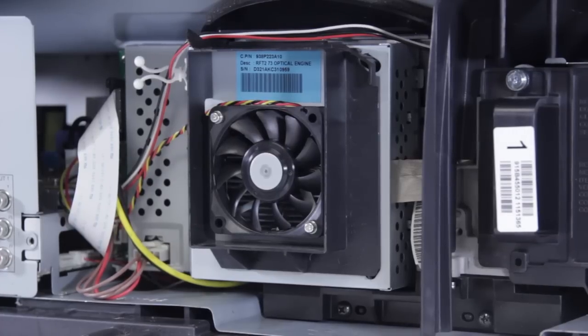If you think your fan is defective, you can find a replacement fan at ShopJimmy. You can go ahead and install a new fan pretty easily — it doesn't take long. It's only going to have one connection and usually just a couple of screws. Once you put in your new fan, you should be able to start your TV up and it should be fine.